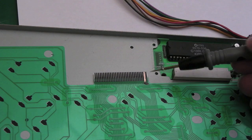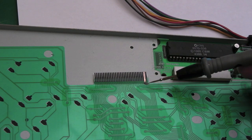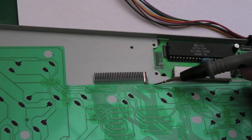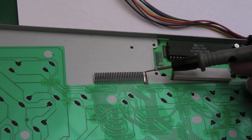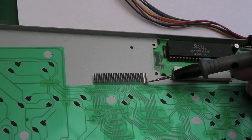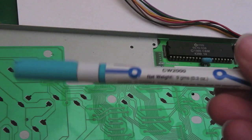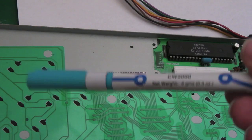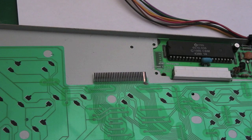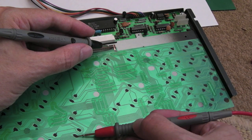Only time will tell - might have to get a new membrane. I tried some nickel conductive paint to start with, but it's old stuff so it might not be setting well in terms of its resistance. I found there was still high resistance there - these other traces are super low resistance, but this one wasn't. So I scratched a little bit of the mask off here just to expose a little bit of the coppery trace. You can do this - it comes off really easy, you just touch it with a sharp tool and it comes off. I've got a piece of copper tape pin-width there, overlapped on the other side so when you push it in it doesn't peel back, and then I've put a tiny bit of conductive ink there.